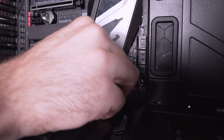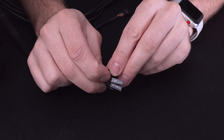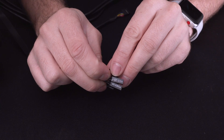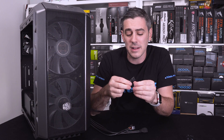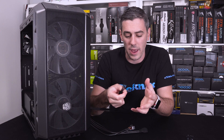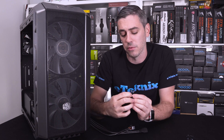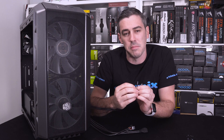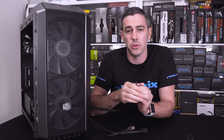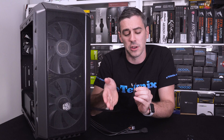When you put these on, you will notice that some of them do have a plus or minus on there. The power LED does have a plus and a minus, so when you look at your motherboard and refer to your motherboard manual you'll easily be able to see which one goes where. The hard drive LED also has a plus and minus, so straight away when you're putting it on your board you'll know exactly where it's going to go.